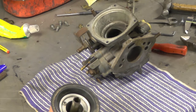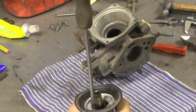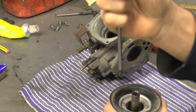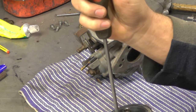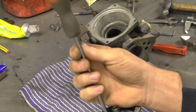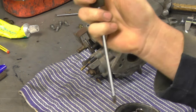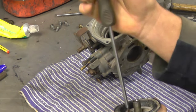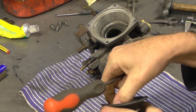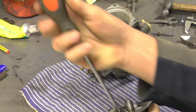Next we're taking out the diaphragm — it's got four screws. Get these screws out carefully because they won't come out quite as easily. I'll say this twice — when stripping and when rebuilding — make sure you've got a good screwdriver for doing something like this. Don't try to use a Pozidriv when it's a Phillips or vice versa, because once you've rounded them off and damaged them you can make the whole job a real pain.